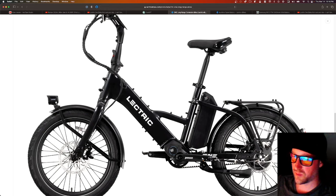And maybe they'll have a bigger one in the future. I mean, I hope they get a 20-amp one that can fit in here. Because 20 amps, to me, that's kind of like bare minimum. Especially when the bike can do 1,300 watts peak. So for this bike to be a comfortable ride for me, you would need a suspension seat post. Let's call it $100. Bigger battery. I'd say it's going to be more than $200, right?